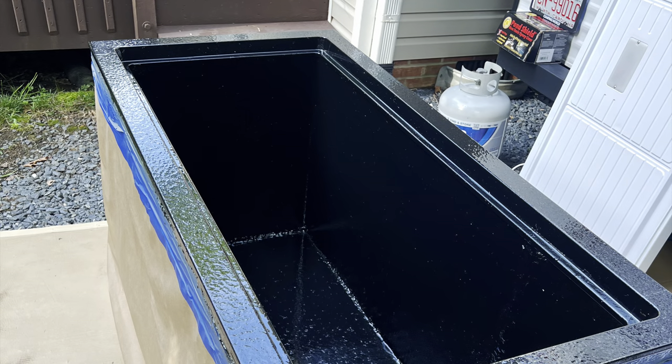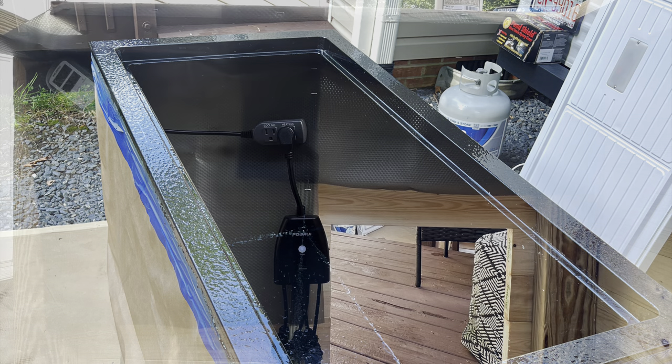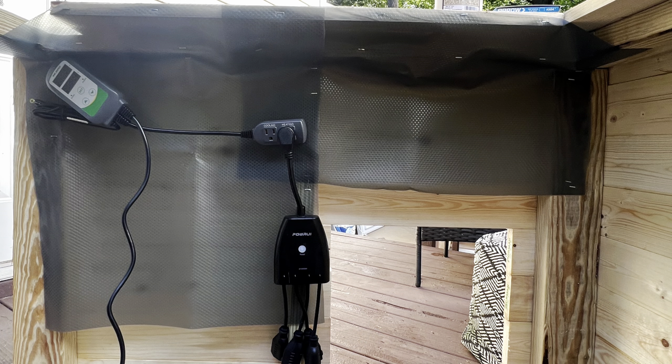Here is the finished product after sealing everything up. Now looking at the inside of the enclosure — before you put your chest freezer inside, map out all your wires, get everything run and ready. Once the chest freezer is inside, you're only going to have about six inches of space to work with, which is what I calculated to make sure the freezer could breathe and cool itself properly. I bought a waterproof membrane at the top so water wouldn't soak in or leak in from rain. I wanted to keep all my wires off the floor — no wire connections sitting on the deck where water could puddle up.